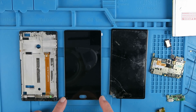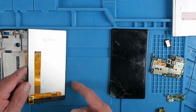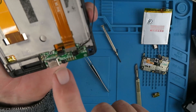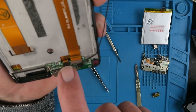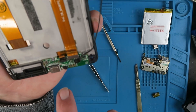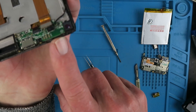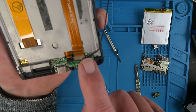But the first thing we need to do is to test it before we stick it in place and make sure that it's functioning, otherwise we won't be able to return it. I notice also that the home button needs to be swapped over. Make sure when you're fitting this board that the little ribbon cable for the home button goes in. There's a white line on it which should just go to the edge of that clip-down connector. Also note that the microphone is sitting under there. That little rubber piece has to have the hole facing to the front. Now I'm just going to replace the little bracket that keeps those in place.